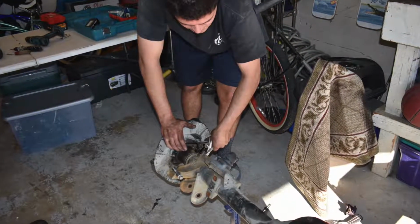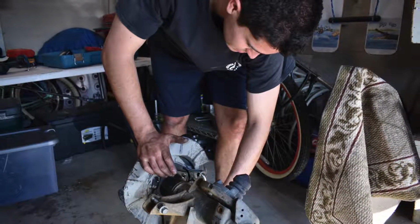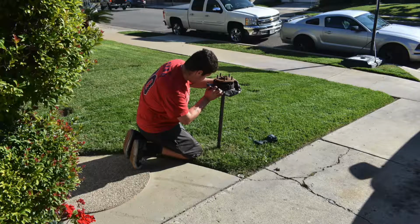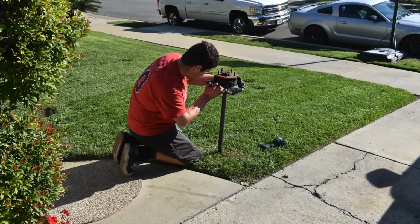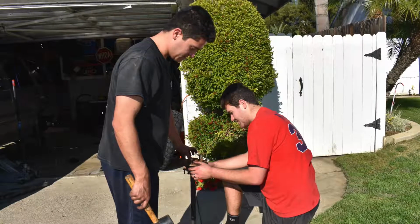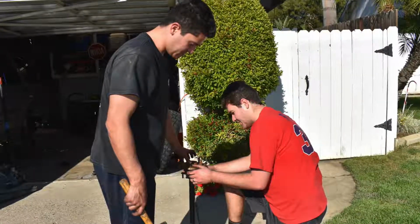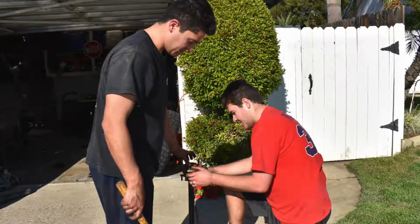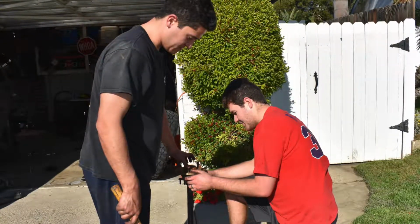Yeah, so at this point the 44 is ready to go in. We're trying to get rid of those bent up e-brake housings. It requires us to slide the axles out of the Dana 44. Kind of use the same method as before. Use the rotor, put it on backwards, lug nuts, rubber mallet, tap it out. Should be no big deal. Ours were kind of bent, in bad shape out from the junkyard, so we had to tap them off using that mallet. Yep, go from there.